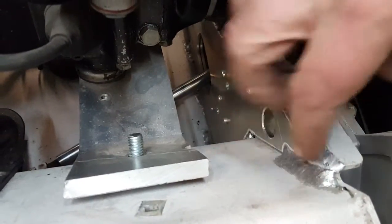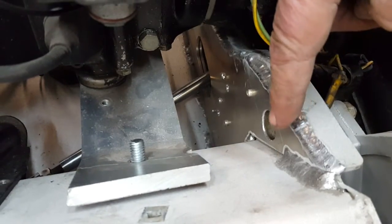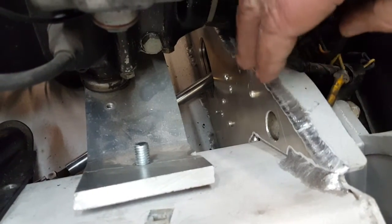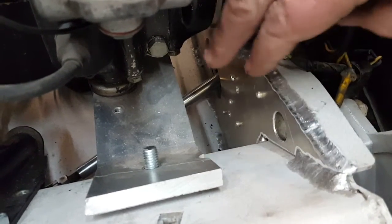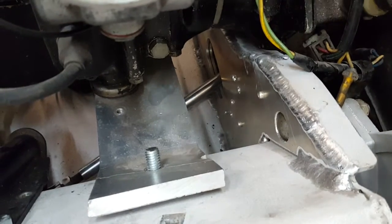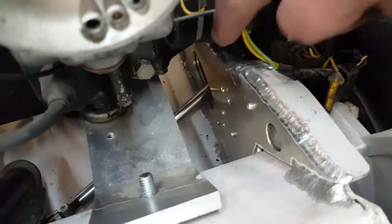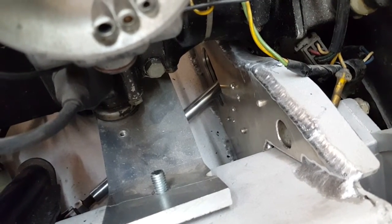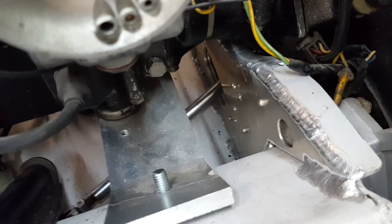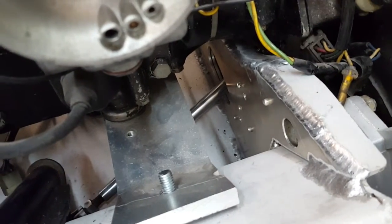And then I've got all this stuff done down in here too. You can see I added a whole other gusset in here down the whole side of this sled over here, just to add extra strength to it. I welded it all the way around. I kind of skip welded it down in there, but then I also put some rivets through the bulkhead into that plate to help sandwich everything together, because as you can see, I had to notch this all out down here for the recoil and stuff on this 650. So just to kind of help make sure everything's nice and strong. Again, I add that gusset. I've done it on other sleds, and I think it works great. So I did it again here.